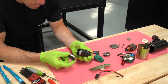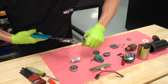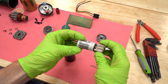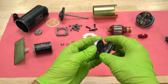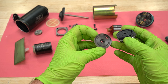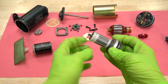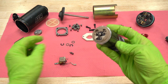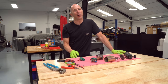Finally got the cap off, and here is the electric motor section. On this one, the magnets don't come out — they're actually part of the can. Just like the other fuel pump, this one also uses brushes that rub on the commutator, but instead of being outside radially, this one's on the top. This is the pump section — the way it works is fuel on one side of the turbine gets pulled through, pushed against the other side of the plate, starts rotating and compressing, and is pushed through a hole, which creates the higher pressure. There are all these small little parts and springs, and if dirt gets in there it can make the pump unable to turn. That's why if you've ever seen someone tap a fuel pump with a hammer and it actually fixes it — it's because it got stuck, and the hammer jars it loose and suddenly the pump works again.